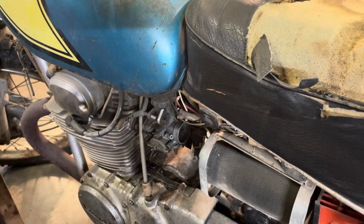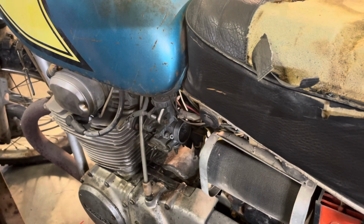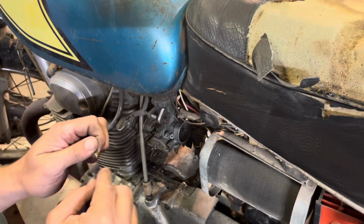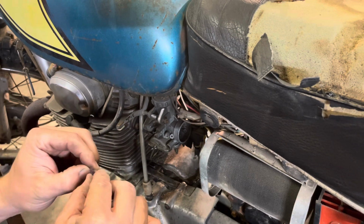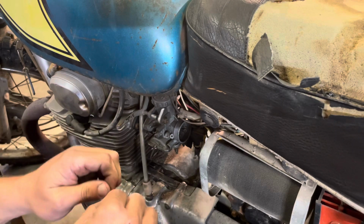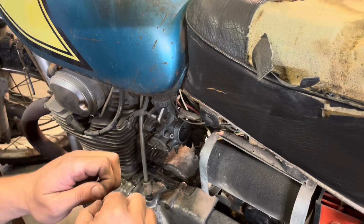All right, now I've got fuel all over everything and some brake cleaner. Same process. Clean my needles. Pretty much every old vehicle or tractor that comes in that's been parked for a while, most of the time, if they were running when they were parked, they usually just need a little bit of work on the fuel system. Clean the carbs out. We usually throw a set of plugs in them. Clean the tank out. Seal the tank if necessary, although I prefer not to do that unless it's pretty bad rusted.